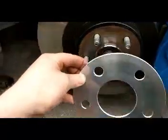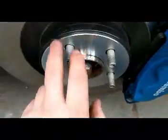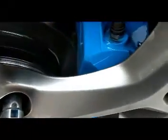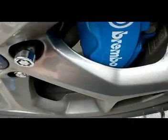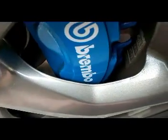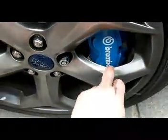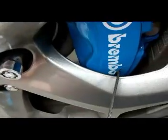and even. Sliding the 3mm on fits pretty good, and you can actually see it's got quite a bit more hub sitting there, so I think that makes me feel a little more comfortable. So the 3mm is installed, and you can see we actually still have plenty of room. When I was looking online, it appears that somewhere in the range of 0.09 is kind of your minimum clearance, and that works out to like 2.2 millimeters.